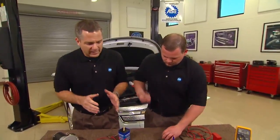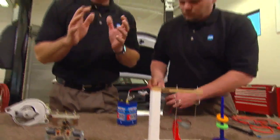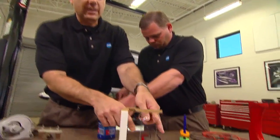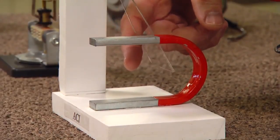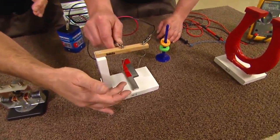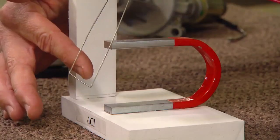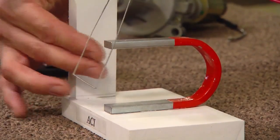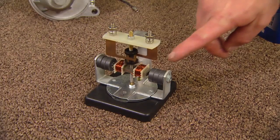Now we take it one step further. We have those magnetic flux lines going from north to south in a straight line — flux lines can't interact with each other, they can't touch. So we introduce lines of flux into this wire. Fleming's left hand rule says those wires are going to oppose each other, so if we start to send current around there, it's going to push that wire back. Through there, there's magnetic induction of those lines of flux — it's pushing from north to south pole. Go the other way and it pushes that magnet out. Nothing's pushing that magnet out except the two interactions of the lines of flux. Our starter motor — north to north, south to south — disturbance of interactions of those fluxes. We'll take a simple motor and take it a little bit further.